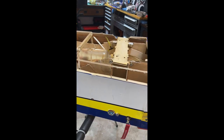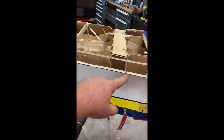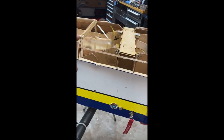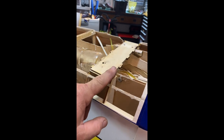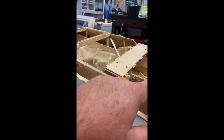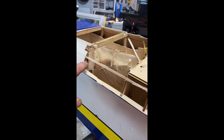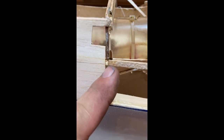I'm going to try to make my video-taking skills a little bit better so you can see this more clearly as it's in process. This is the one side where I took off that whole panel — if you look back on the previous video, I took off this whole damaged piece. You can see the formers inside here — the ribs. I need to extend those up a little bit so they'll take the forming of the skin. I've put one former inside here and put a doubler behind it on both sides to give it an anchor. I did recess it inside that slot a little bit, as you can see — it's been cut in and made to fit, with a doubler behind it for added strength and security.